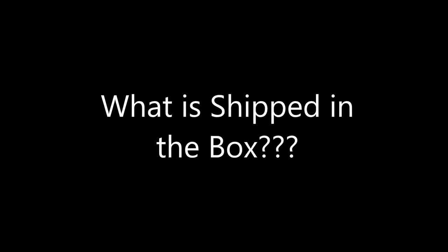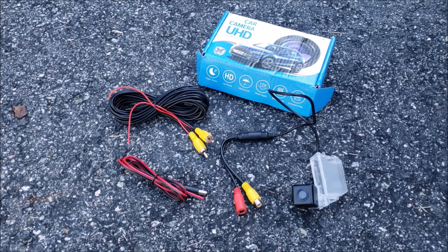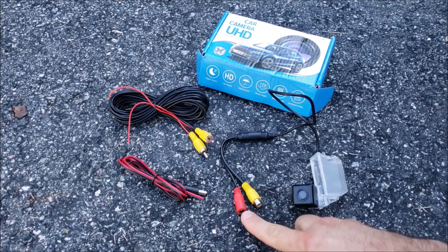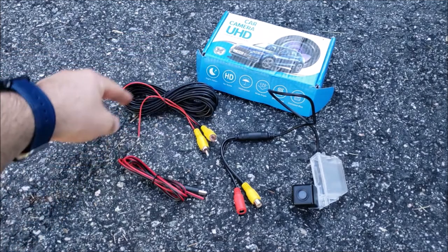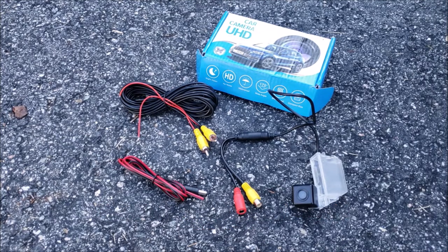Before we get started, let's talk about what comes with the camera. This is what comes with the $25 backup camera kit off eBay — just a generic box. It doesn't have an Escape or anything on it, but this lamp housing does fit the lamp housing above our license plate. I have a whole install video if you're interested in doing this yourself — I'll link it in the description below. From the camera comes a video input/output and a power input/output. The video input/output plugs into this long cable, which routes to the front of your Escape and plugs into the two pins in the connector behind your A-PIM module and your stereo.